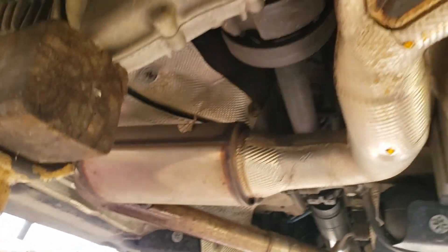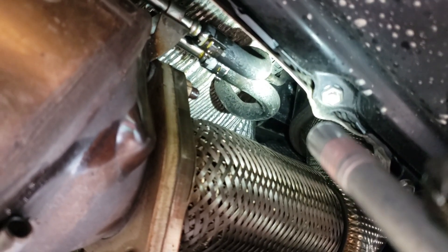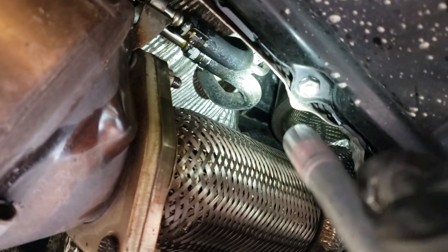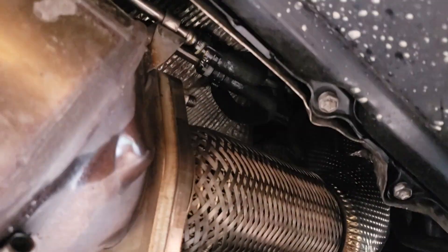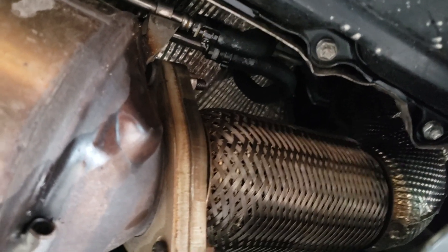There are a couple of sensors on the bottom we get asked about all the time. First, there are these rubber hoses. Those rubber hoses go up the body to the DPF differential pressure sensor. They connect to metal pipes up higher because they have to allow for body movement with the engine and transmission while you're driving. Those hoses get reconnected to another DPF. Our off-road customers have those hoses zip-tied and moved off to the side.